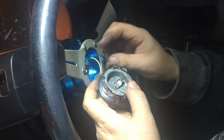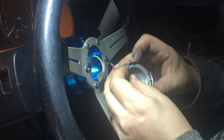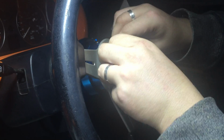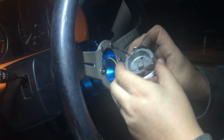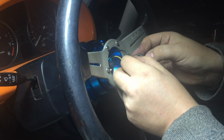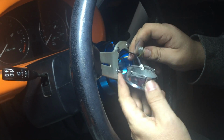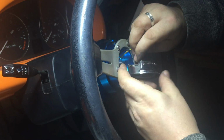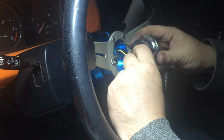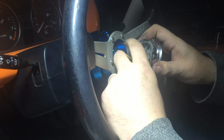But there's no connector to connect that to, so what I'm going to do is take one of these spring-loaded clips. And this is a bit of a jerry rig really, but I'm going to thread that through the hole in the spade terminal to get that in place there, and then I'm going to pop that spring-loaded clip back into its home. So that's going to keep that earth connector connected, stop it from flapping around inside and possibly setting off the horn. Switch live, I'm going to plug in to the terminal. There, see what I'm doing, and accidentally blow the horn, confuse passers-by.